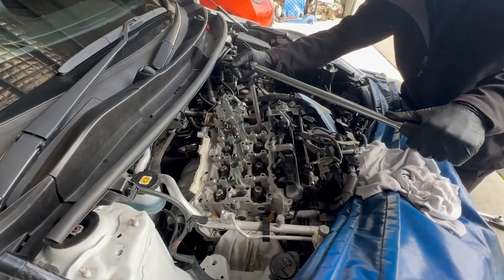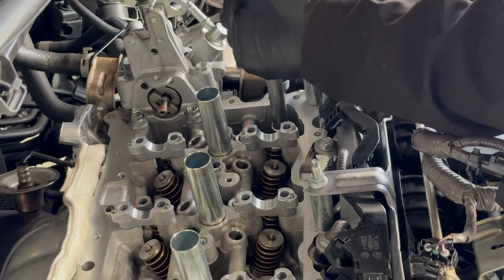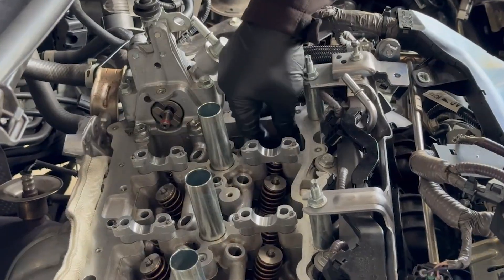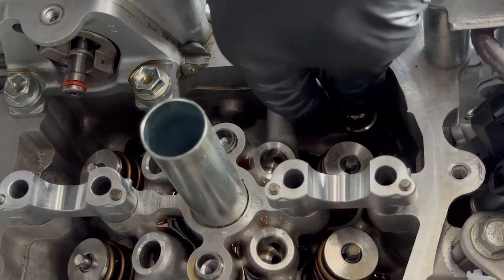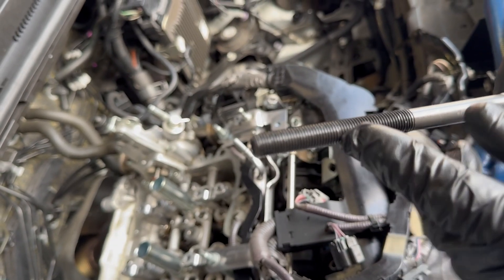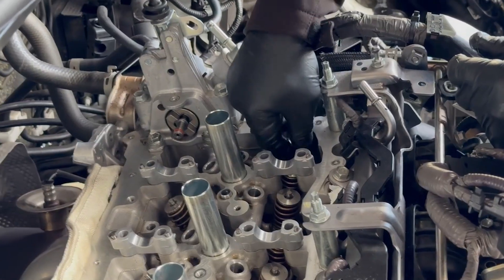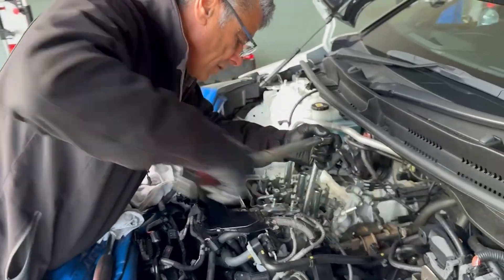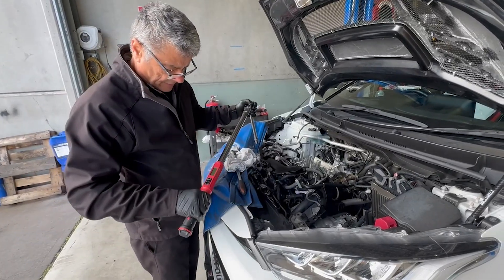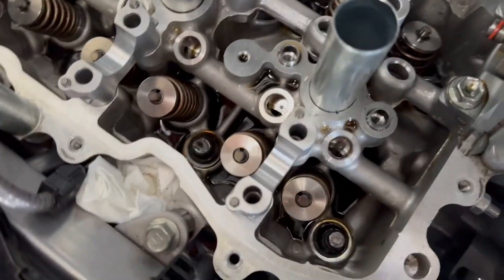The end ones are the 11mm studs but the head of the bolt is 12mm on these factory ones, and 12mm on the middle ones too - the diameter changes. We'll take the old bolt out to see how far it went into the block. You can see how far it screwed in - and there's unused thread above. First torque to 80 Newton metres, then up to 108 Newton metres for the M11s, making sure there's enough bite down the bottom.